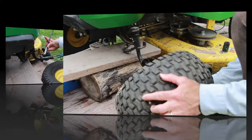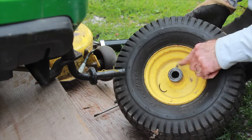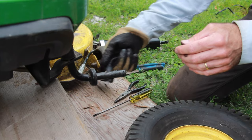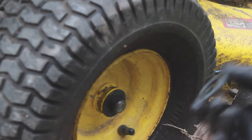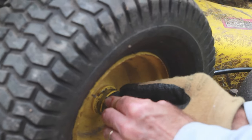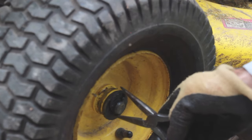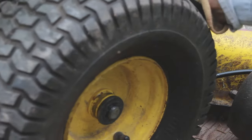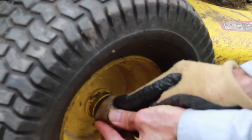That really is all there is to it. Before putting it back on, I'm just going to put a little bit of grease in there — you can do that right here as well when the wheel is mounted. Put the tire back on with one well-greased washer, and then it's just the C-ring — get it in the slot. Use your pliers or needle nose; channel locks work nice. Place the dust cap using the pucker technique.